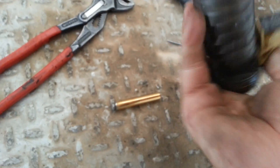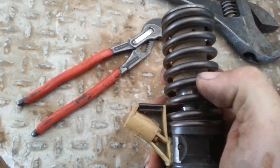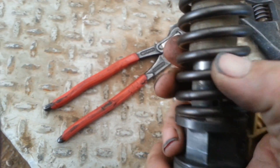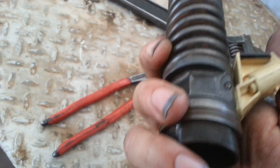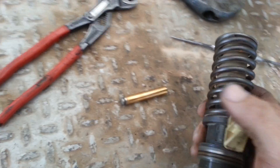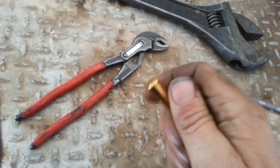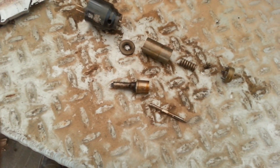There's the body. Right in here it's like a pin right there, then 180 degrees there's another pin right there, which rides up and down that groove right there. I couldn't pull those — looks like you need a special wedge tool or something to get up underneath there to push those pins out. Basically it's stripped down now, and we revealed the plunger assembly right there. At the injector tip, it's about 40,000 PSI injection pressure — 40,000 to 43,000, something like that, best I remember.